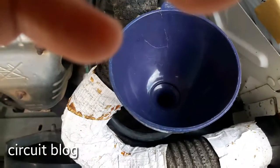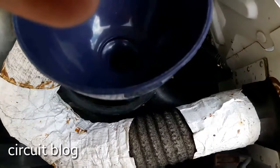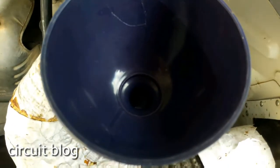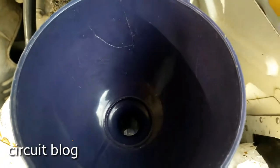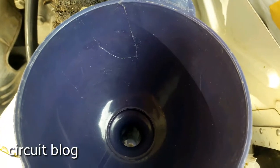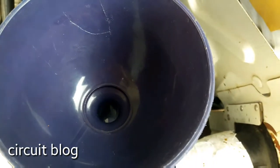The car has been lowered down to the wheels, and I removed the gearbox cap using an adapter that I made for this purpose. I put a funnel with a hose in it and inserted it into the hole. Now I'm going to pour the new oil. According to the manual of this car — it is a Dacia Supernova — it requires 3.5 liters of oil to reach the correct amount in the gearbox. So I'm going to pour it and we will see what happens.